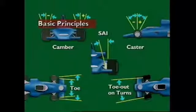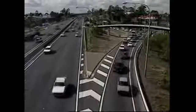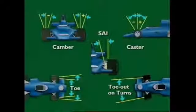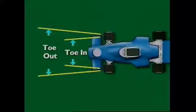This section examines basic principles of wheel alignment. All wheels of a vehicle must be correctly positioned with the vehicle and with each other for the vehicle to drive and steer properly. A driver should not need to keep manipulating the steering wheel to maintain the vehicle in a straight ahead position on straight level roads. Similarly, little effort should be needed to turn the vehicle into curves or to let it return to the straight ahead position when the curve has been negotiated. Wheels are installed on the suspension units at certain angles to provide for these factors — these angles taken together are called wheel alignment. The factors that affect wheel alignment are camber, caster, steering axis inclination, toe-in, toe-out, and toe-out on turns.